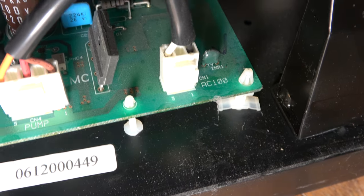Right, I think I've done a reasonable job of soldering that diode on there. I know I should really take the whole board out and desolder from the pads, but rather than go through all that hassle, I've just soldered it on the top. This is a 1-watt diode, so it's got fairly thick leads compared to the original. So that's all very stable.